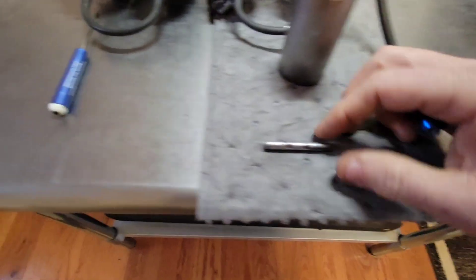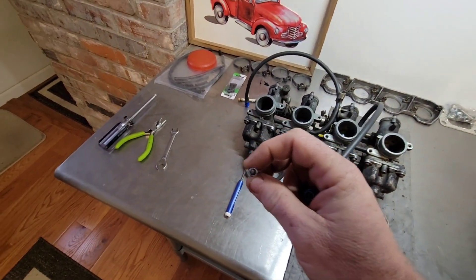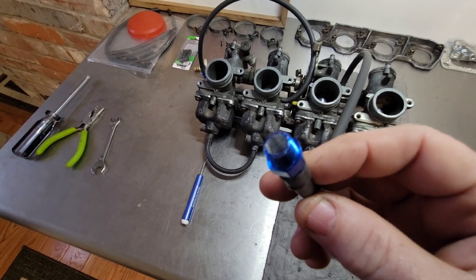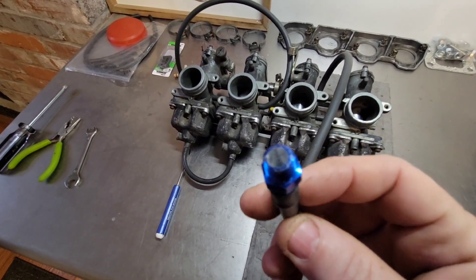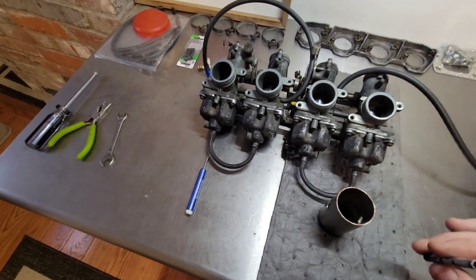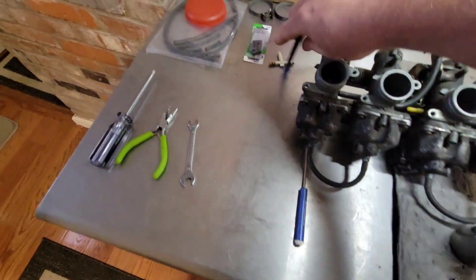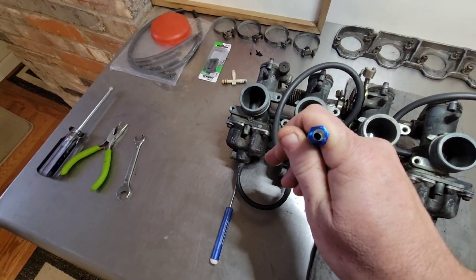There's the tube. As you see, the air can go through from both sides — it's hollow. These I machine out. It's perfectly machined to be a quarter-inch on the inside of this fitting, tapers down just a little bit so that the air from the tube — see the tube, how it's got a little bit of wall diameter there — that wall diameter meets up with the inside of the fitting and the airflow is perfect.